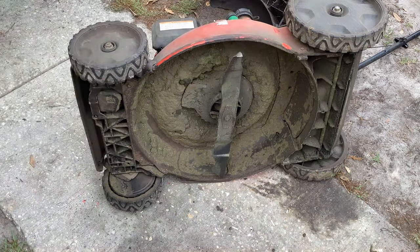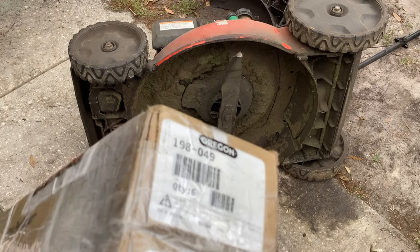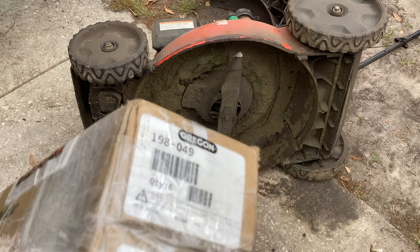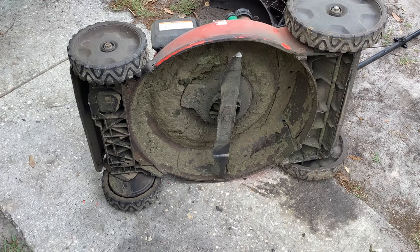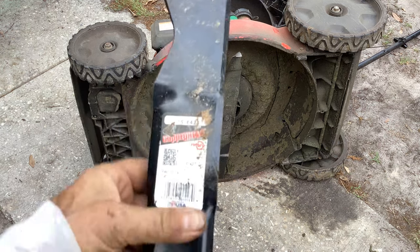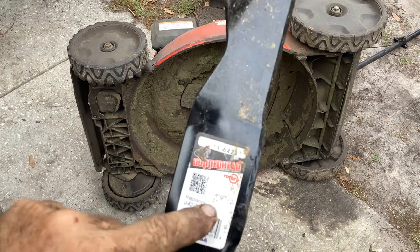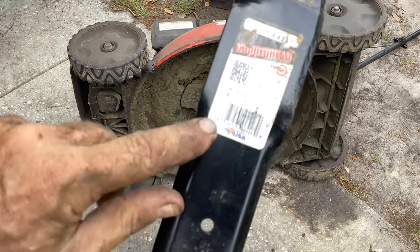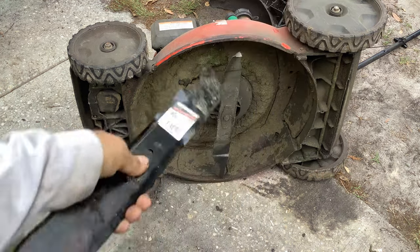This thing needs a bath. The air filter didn't look terribly bad; it's got a stock plug so nobody's screwed with that. But look at this thing — bent down here. Let me get it off and compare it to the new blade. I got a 12-pack of Oregon blades — the number is 19849 — the bowtie 21s. And here's a Rotary number 156423; the OEM 21-inch bowtie is 942-0741. We'll get this one off and compare the length.